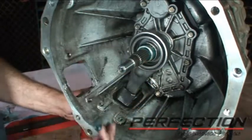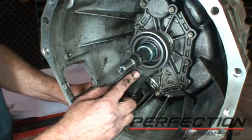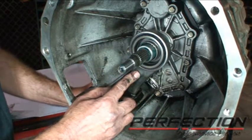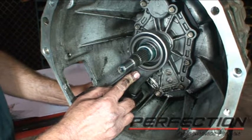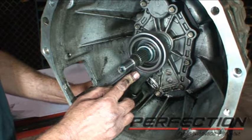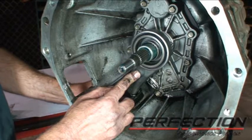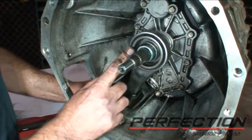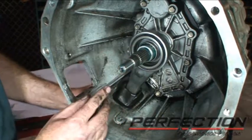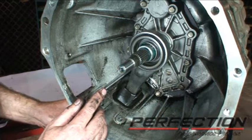I'll clean up that grease. This position would be released so you can shift gears — engaged, released, engaged. As the system wears, the fingertips get higher and the bearing moves back to accommodate for wear. Nice and smooth, and the bearing turns freely. Let me clean that up and we'll test fit the disc and lubricate the input shafts of the transmission.